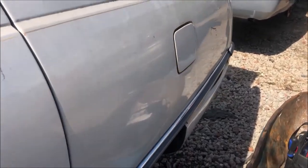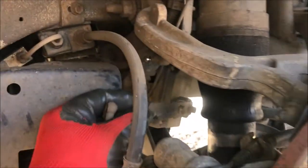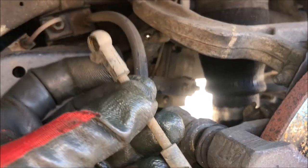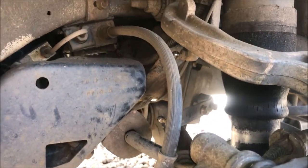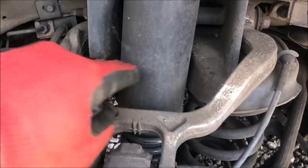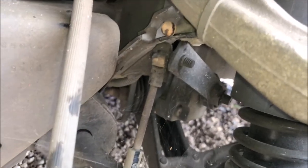There's no better place to learn about vehicles than in the junkyard. This is a 1995 DeVille — I'm at the left rear of the vehicle with the wheel off, and that arm I'm articulating is the level sensor. The suspension is connected to that arm with this rod. I've already disconnected that and I'm going to disconnect the sensor with these two bolts and then electrically disconnect it. This DeVille had its auto leveling system disconnected — they put a standard shock in with extra coils to keep the rear end leveled. The air hose is not connected to the shock but the level sensor is still in there.